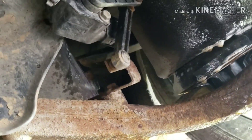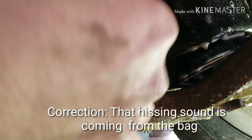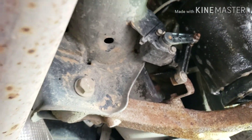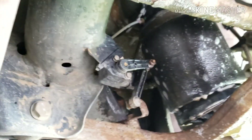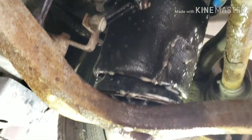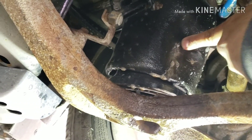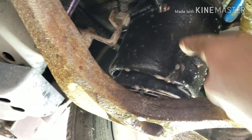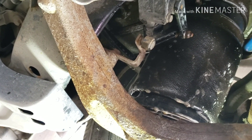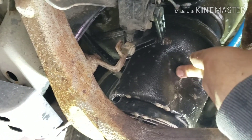I can hear the reservoir tank hissing. I'll spray on the hose to see where it leaks. See how soft this bag is? It's supposed to be firm already. Somewhere is leaking really bad — that's what's causing the vehicle not to raise.